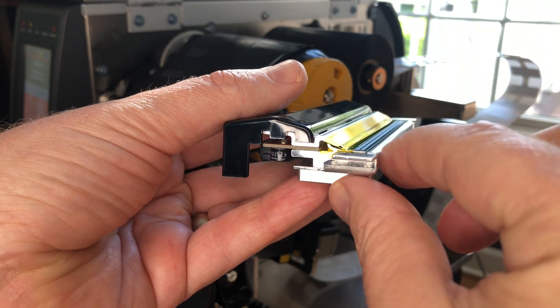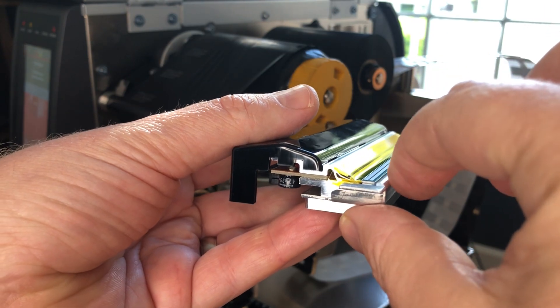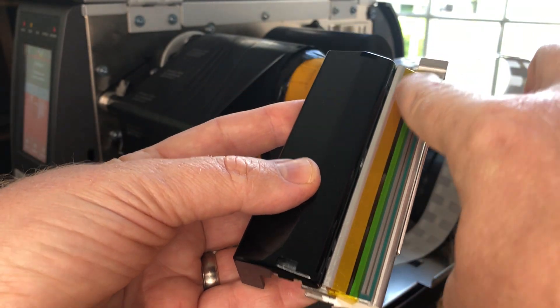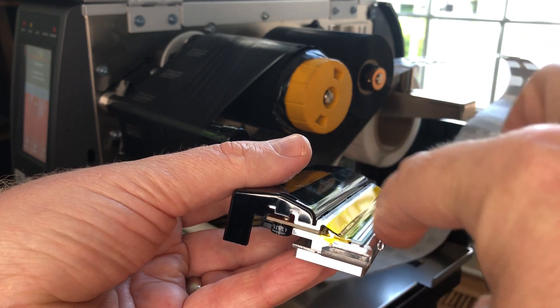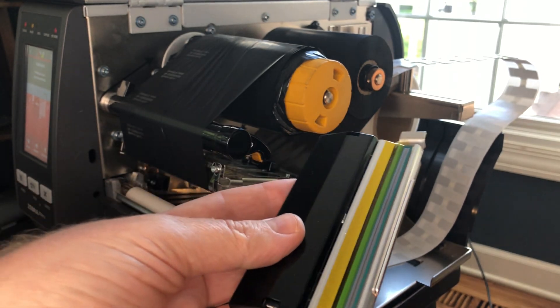The first is this front bezel on the front. We've really smoothed this whole profile out, and this rounded bezel prevents labels from getting caught as they're squeezed and that foam squeezes underneath the printhead. The second piece is this cap down here, which covers up the gap in the back and similarly helps these thicker foam-based labels slide across that printhead profile without getting caught or stuck.